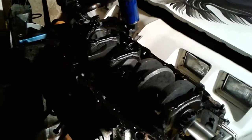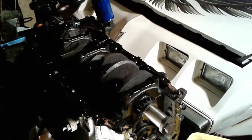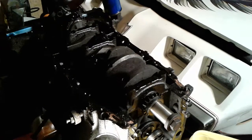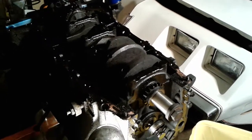But if all you can get your hands on is one of these windowed blocks — which would be a 1977 through 1980 for the 350s — it's not that big a deal. You can still put older parts in them, put better heads on them, and they'll take good abuse if you're doing normal driving, like 5,000 RPM stuff like that.